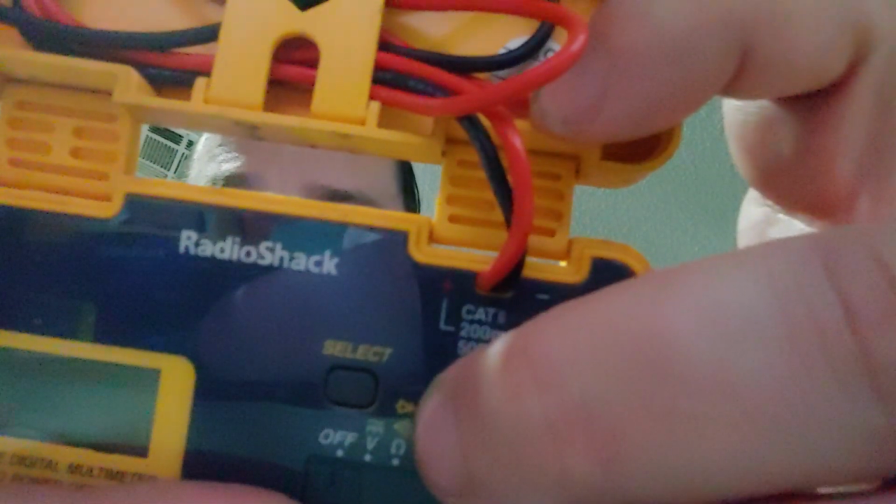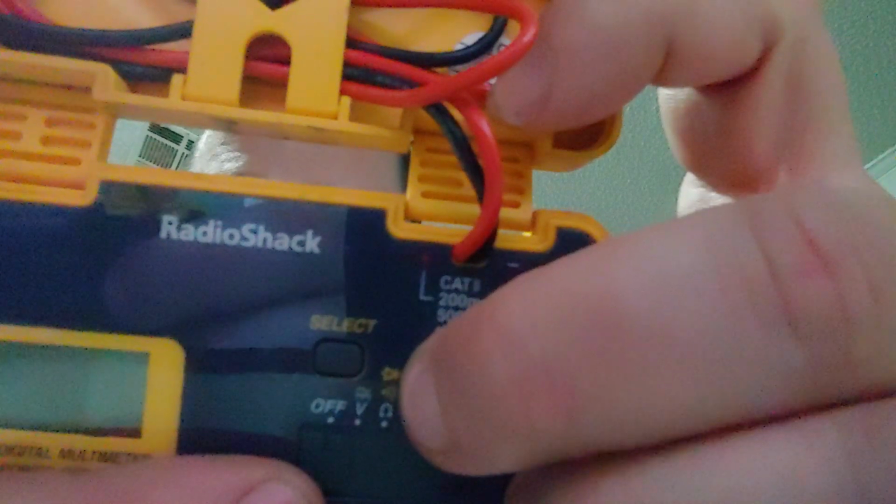If they are all the same, or they only have 2 contacts, which means they're all the same, polarity doesn't matter, then you need to test them. So what you do is you put a meter on those 2 contacts of one of the switches that does work. Okay? You put your meter in continuity mode. So if you have a little meter, you'll see a symbol on it, something like that. See that one with the little bell? The little speaker icon there? Okay, that indicates continuity mode.